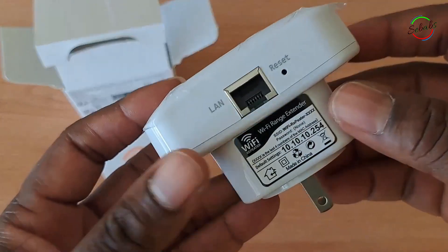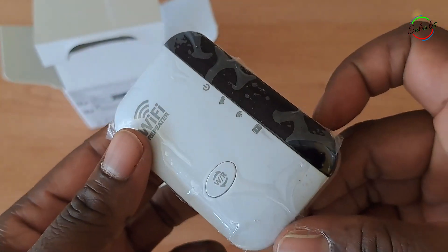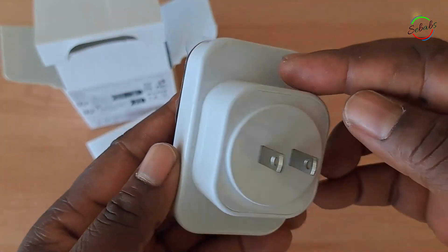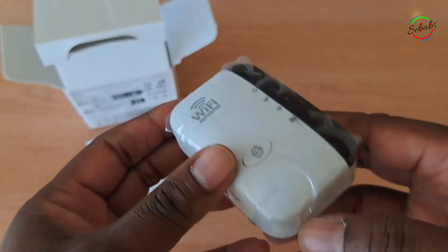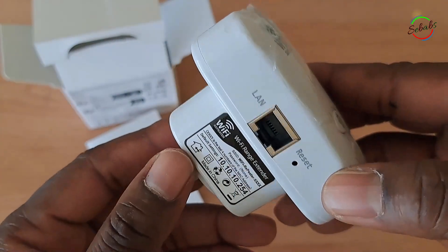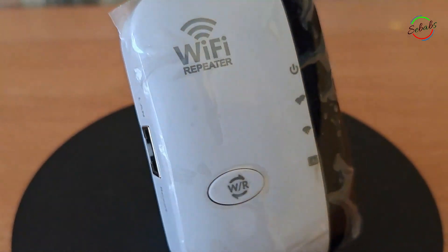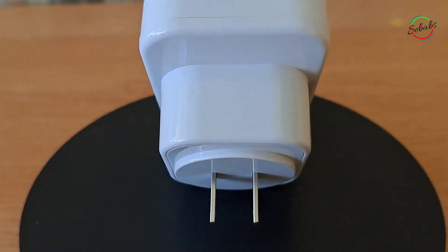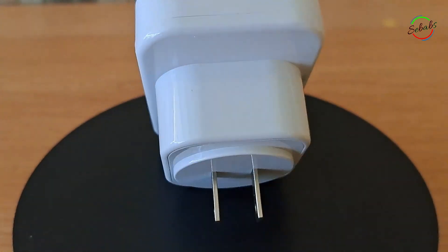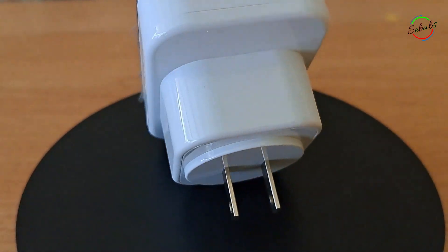In short, setting up a Wi-Fi repeater is not that difficult, but it does take a few steps. You have to log in to the setup wizard through an internet browser, then link the repeater to your existing network. If you're thinking of getting a Wi-Fi repeater, first try repositioning your router and updating its firmware if it's old. If your router does not provide good enough Wi-Fi coverage, a Wi-Fi repeater would be able to help — but if your coverage is already good, you don't really need one. I appreciate your time watching this video. If you have any questions, please leave them below. If you like the video, don't forget to give us a thumbs up, subscribe, and click the bell button to receive notifications. Thank you for watching, and catch you guys in the next one. Peace.